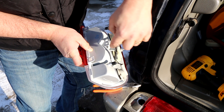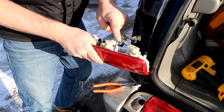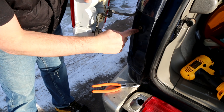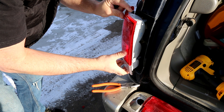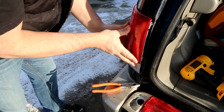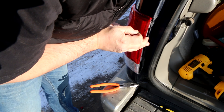There's a rubber seal — make sure that's in place, that's what keeps the moisture out. This goes right into that yellow receptacle. Also move the harness so that you don't get a short in the wire. It's in — you've got to push it in the rest of the way. It goes into here — see that little plastic part? Line it up.